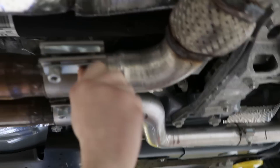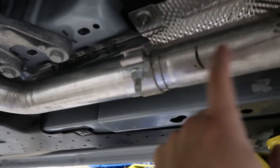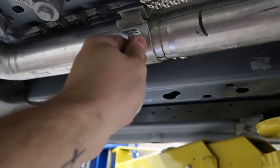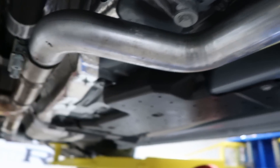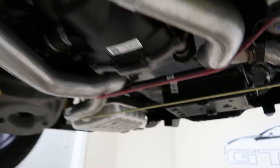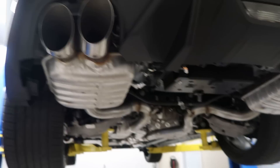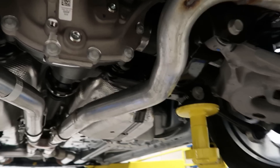We had a little trouble up front getting the piece to fit right because these clamps are super hard to release. In case you're ever having trouble, just disconnect right here at the downpipe where the cat is — loosen that up, don't take it completely off, so you can rotate and wiggle it a little more just to get it in. We did this in a quarter of the time it took me to do mine. Colin's mufflers didn't fall either because I pre-bungee corded them. Now we just got to button everything down and drop it off the lift.